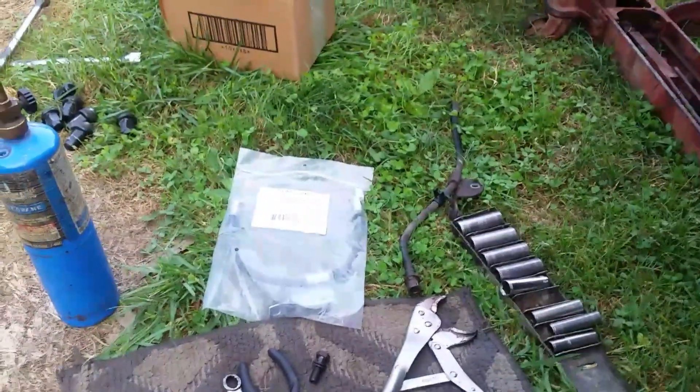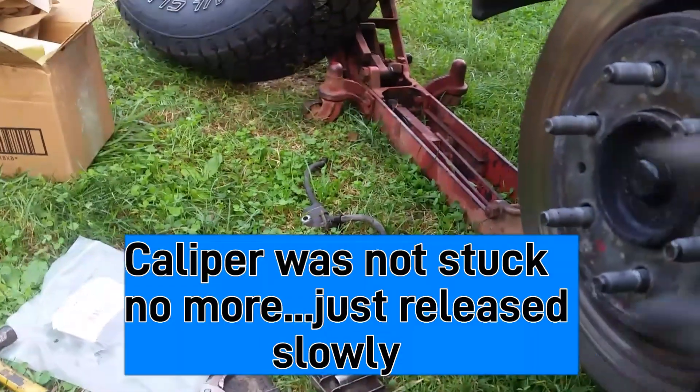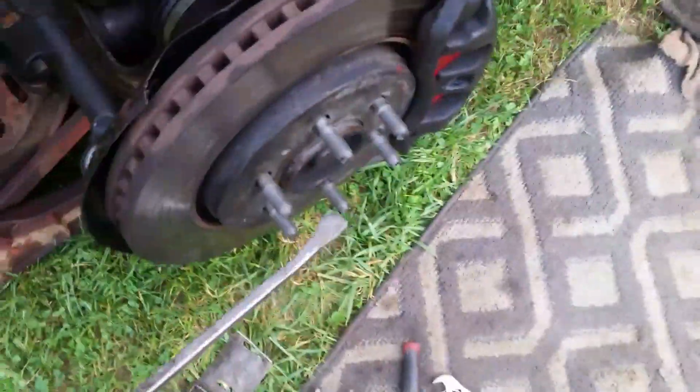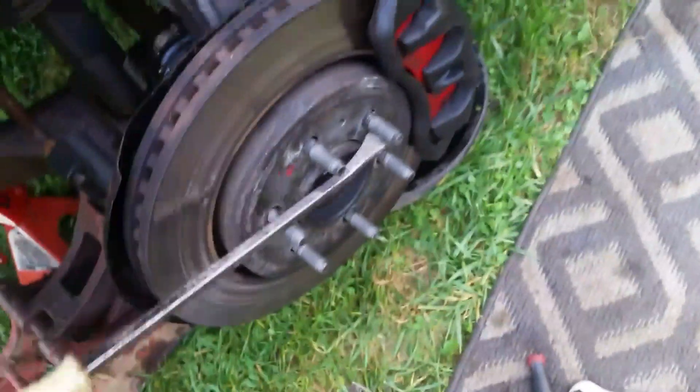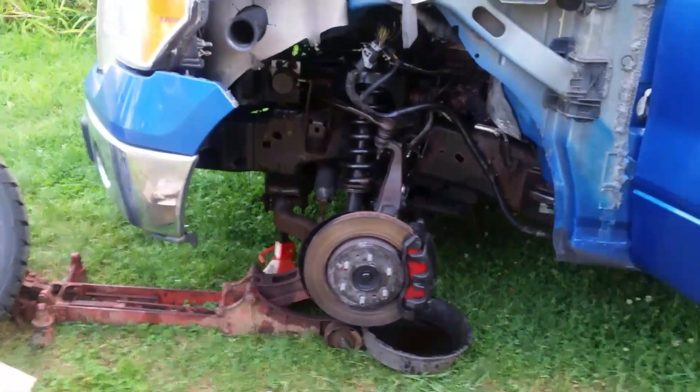We got us a new one to put in. Just like that she's all done - we've got our bleeder here open and she's pouring out. We can close this up, the system is pretty much bled. There's our new line and there's the old one. Always check your lines if you're doing brake jobs in case you have a problem on one side. I went inside, pumped the brake, and look at that - we can turn it now, not locked up anymore. Push down a couple times, hold her down - got a full pedal and I can turn this pretty easy. No problem! Always check the brake line, you never know. If you like any of my videos give me a thumbs up - see you later.